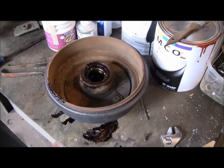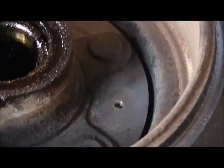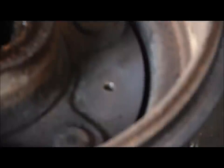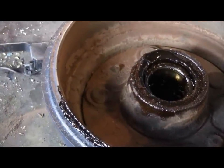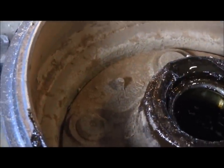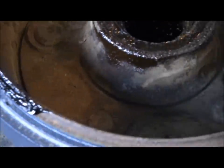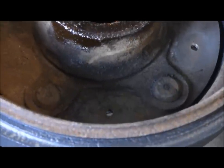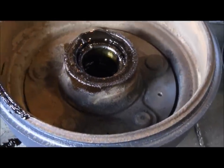Here we've got the hub off on the workbench and we're loosening those screws. Another good reason for doing it from the backside by pulling the whole hub is you can heat around the hub right where the screw is — heating the hub, not the brake drum. When you heat around the actual hub where the threads are, instead of having to heat through the brake drum, it's much easier to get the heat where you want it and get the screw loose. So far we've got two of them loose.